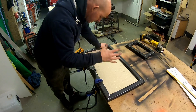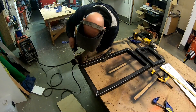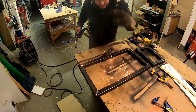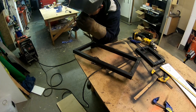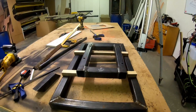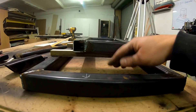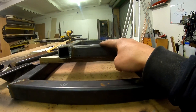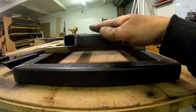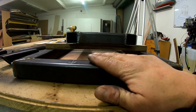We're all cut on 45 degrees and I've cut my piece of wood for the centre to act as a square. We've now got both pieces together. From the bottom of the sump plug to the base of this is 90mm, but I've allowed 100mm. We won't be extracting oil through the sump plug anyway - we'll be using a vacuum pump. So these are now setting the height. We need to work out left-to-right and front-to-back positioning in relationship to the bottom base that the sides are going to attach to.